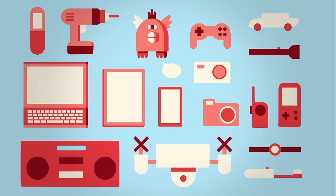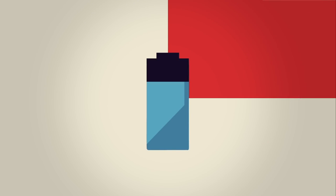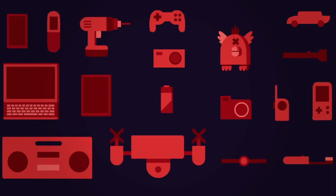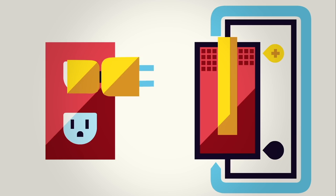For example, if you continuously work on the computer — for school or a project — for six hours in the morning, it's definitely better to keep it plugged in. You don't need to drain the battery all the time. But this doesn't mean you should keep it plugged in 24/7. If you're using the Mac this way, you can unplug it overnight and let it discharge a bit — it is a laptop, so use it like one. Generally, the best way to prolong battery life is to keep it somewhere between 20% and 80%, charging periodically to stay in this range.